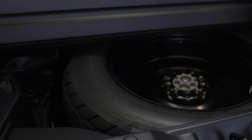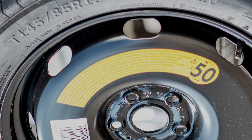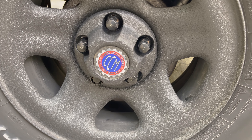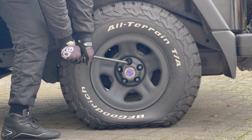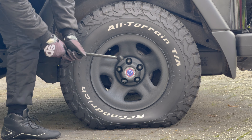When your car is in a good spot, you've got to find your spare tire, jack, and wrench. Usually these are located under your trunk. Make sure the spare tire isn't flat or cracked — replacing one flat tire with another is not going to help. And remember, depending on the type of spare tire, speed and distance might be limited, so make sure to verify this.